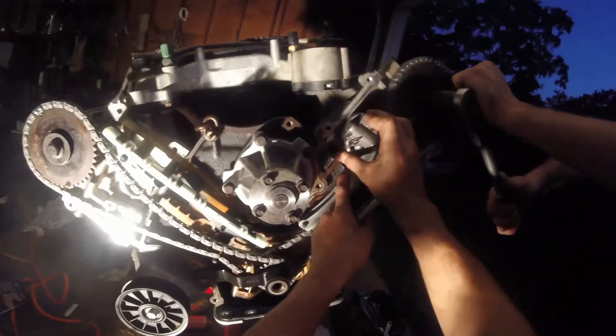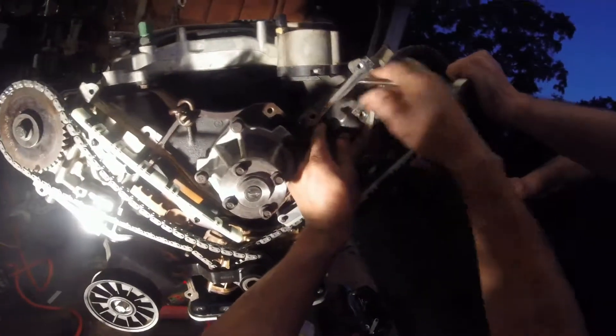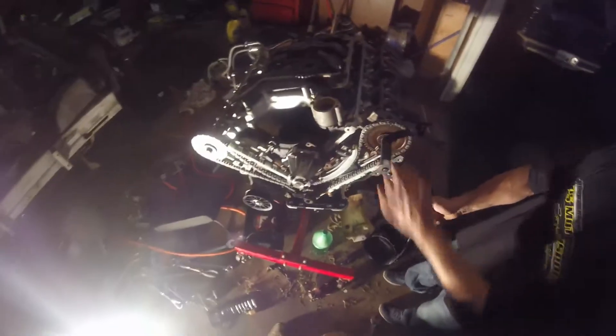We can get the guide on. Both of these might be the same — one of them has to stand out. This would be the back chain, so that'll be the shorter one, just like that. Then you want to grab your left tensioner for the driver's side, grab the bolts, and start the bolts on the tensioner.